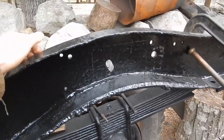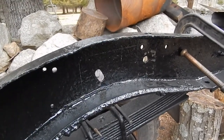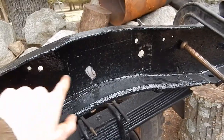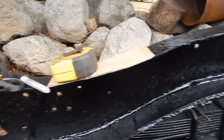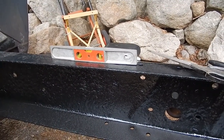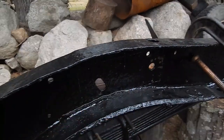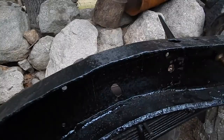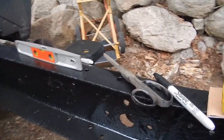The first challenge I encountered — you might not encounter this if you use a thinner piece of angle iron — was when mocking up the piece of angle iron. Since I'm not on perfectly level ground, I used a level on a straight section of frame to determine what angle the frame was at, then used a clamp to loosely clamp the angle iron in and used the level to make sure that piece of angle iron was parallel to the frame.